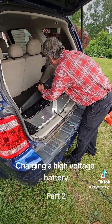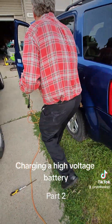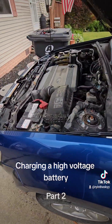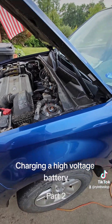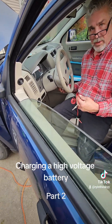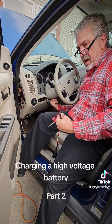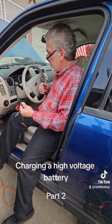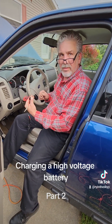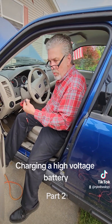Plug in at eight o'clock, turn it to nine o'clock. Now we're going to restart it — hopefully it all starts right up. Push back on the ignition switch — you're turning it forward while pushing the ignition switch back to help them meet, so that way if you flip the switch it doesn't push it too far forward before it actually engages.